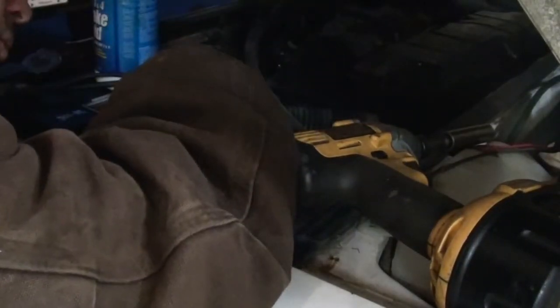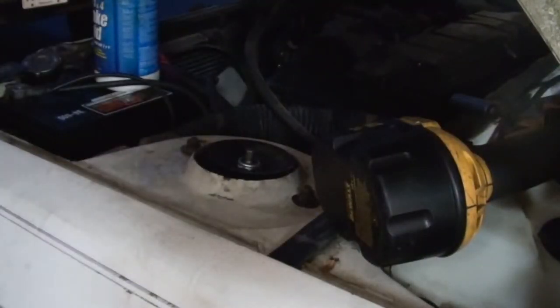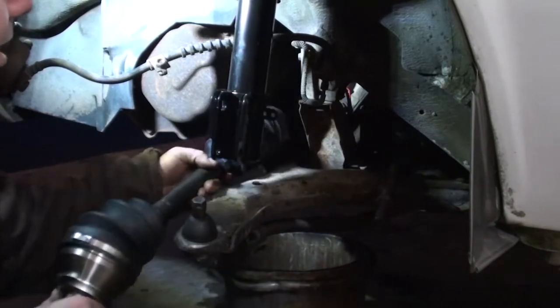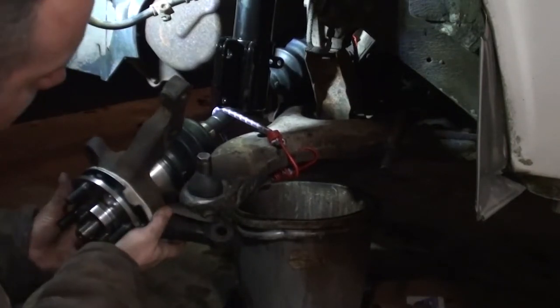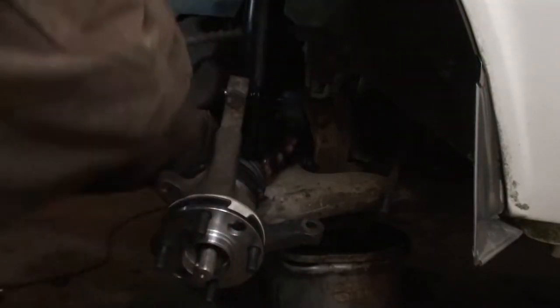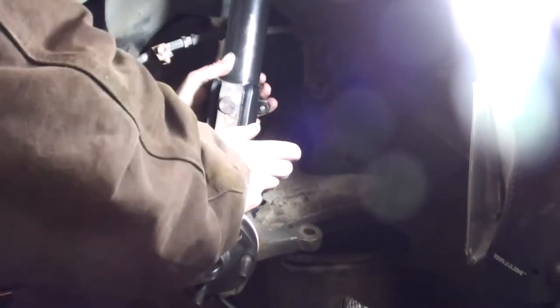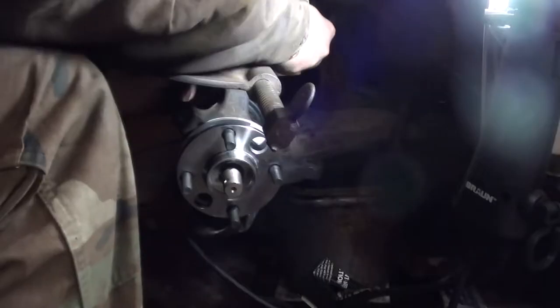With all the lower end components in, it was time to put the shock towers, struts, and spring assembly back in. After messing with them, putting them together and taking them apart, I finally got it right and was able to mount the shock towers back to the stock position so they would turn left and right freely. Once I had them in position it was a matter of tightening the bolts up on top, waiting until I got the car on the ground before actually torquing them down. The trick on this car was to release the sway bar — I had a heck of a time trying to get the knuckle to mount into the shock tower mount, pushing down on the control arm and it just wouldn't go. Once I loosened the four mounting bolts on the sway bar so it wasn't pressing on itself, I was able to drop the control arm down and work it in there.